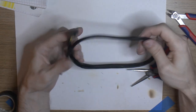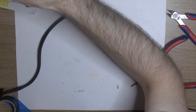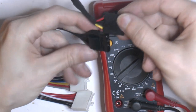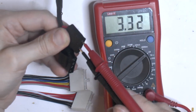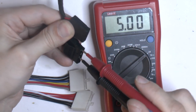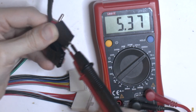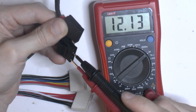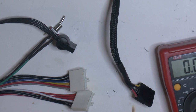I'm going to see if we can power this up. I need adapters for turning the system on. Comparing the new cable and the original: checking +5V on both connectors — they match. Checking +12V — they match. The cable is ready to use. Time to put the power supply into the system.